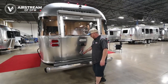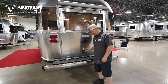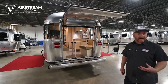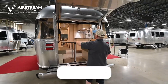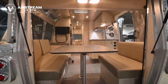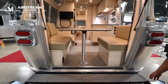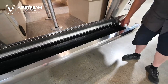This model has a hatch on the rear. This is the handle that'll open and close it — you can also lock it from here. Give it a quarter turn to lock it, then you can return the handle to neutral and it still stays latched. Unlatch and return to neutral and it'll just open right up. You're going to have a hard time opening the hatch when you have the rear awning out — the awning is not designed to hold it and this will run into it as it opens, so I'd recommend against opening the hatch with the rear awning out. You have a bug screen that can drop down to let you enjoy this space without insects coming inside. Back here we'll find a plug that works off the inverter, as well as one of the vents for the furnace. Below that is the wet storage compartment — the bumper or trunk storage. When it's closed it's not completely sealed, so don't put anything in there that you're concerned about getting wet.